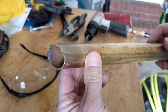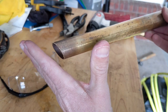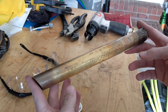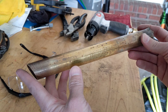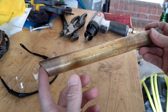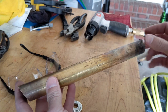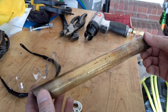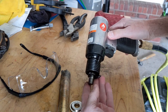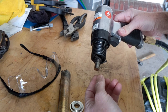I've got a piece of 1-inch brass tubing here. The Boston Whaler 13-foot has a pretty steep angle on the back of the stern, so this tube needs to be 12 inches long. I recommend cutting the end to your angle and leaving three or four inches extra on the end so if you mess up the flare you can just snip it off and retry. Once you get the flare right, you can put it in the boat, mark it off, then flare the other side with the o-rings in place. An air hammer works fine — you can get one as cheap as $13 from Harbor Freight.